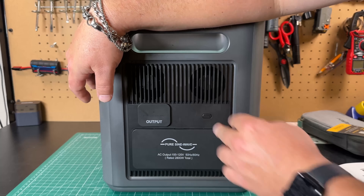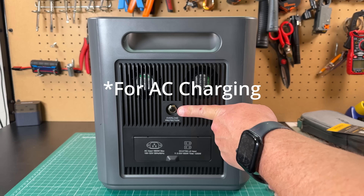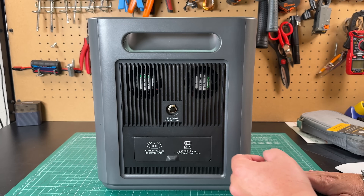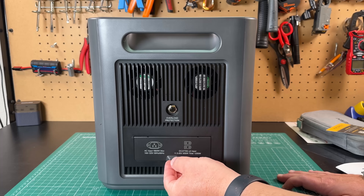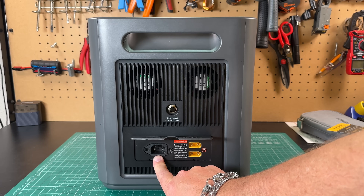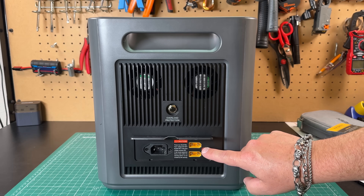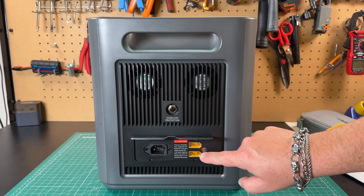You've got your intake fans here for cooling. Taking a look at the left-hand side, we have an overload protection — this is for charging, like a surge protector. If you're charging and you get a surge, that's going to break. It's just the charging circuit breaker. There you can see the two fans that push air through and keep this nice and cool. And if we lift this flap, we have our 120 volt AC input for charging up to 1,800 watts, and then here we have two 600 watt solar inputs that can take a voltage up to 55 volts — I think it's 11 to 55 volts of solar input.